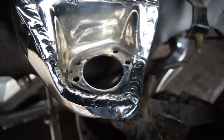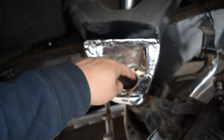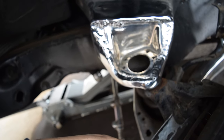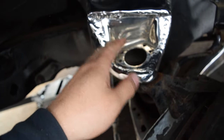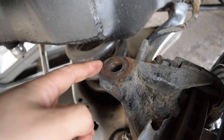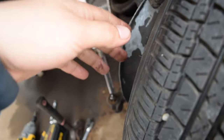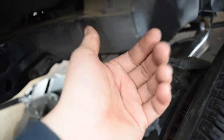Next order of business. Now that we got our original ball joint out, we're going to go ahead and see if the new one fits, which more than likely is probably not. So then from there, we're going to have to make the hole bigger using a Dremel or something. And then we're going to have to make this hole bigger here. I got a 5/8 drill bit, and once we get that drilled out, then we should be good, boys. Hopefully. Stay tuned.